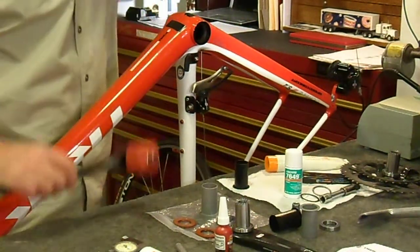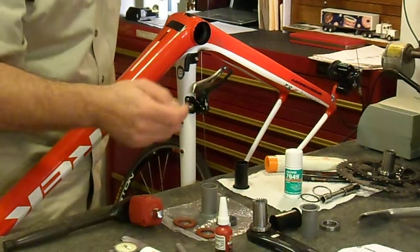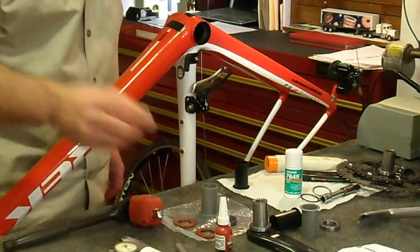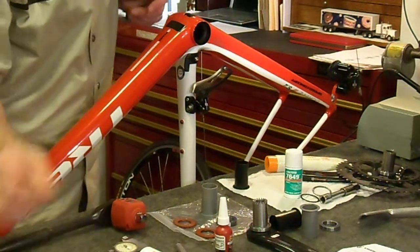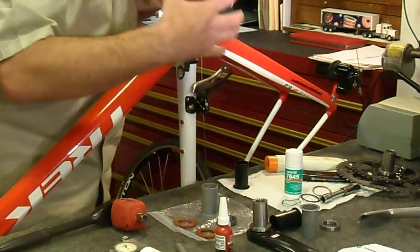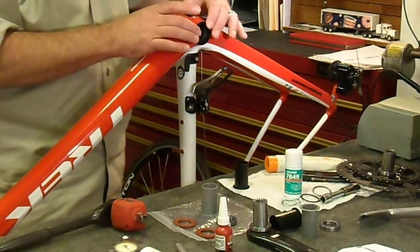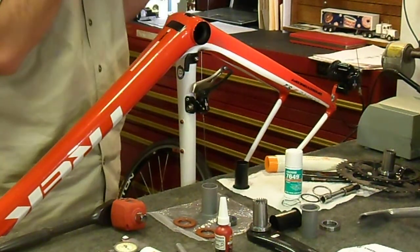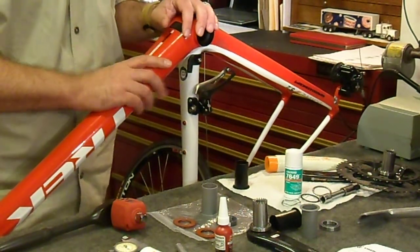Finally, when you go to tighten up the two crank halves, there's a nut that needs to be tightened down. This takes about 371 inch-pounds, or around 42 newton-meters, with your torque wrench. The gap will be taken up by the wavy washer, so you just tie those two together. I was a little concerned about the distance on this bottom bracket with the seal seats, but none of that really matters — it just floats right in there. Hopefully this will help you save time, and good luck when you go out and do this.